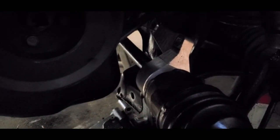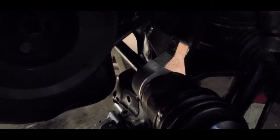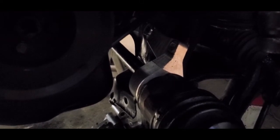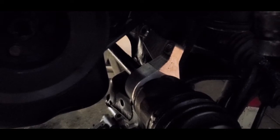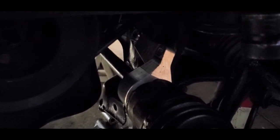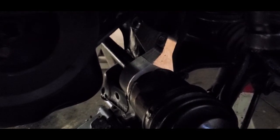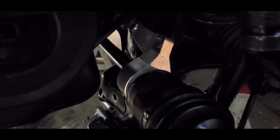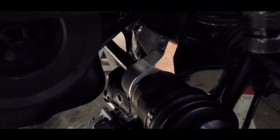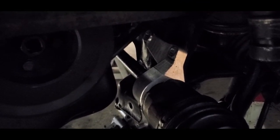IPT Transmission sells a seal — it's a brand new seal with a couple small spacers behind it that push the seal out a bit. I purchased it; with shipping I think it was around $50. I didn't end up using it though because I already had the Jeff Bush bracket, and I realized I only needed one or the other. I have no experience with the IPT seal, so I can't give feedback on it. But anyway, for a six-bolt 2G you do need the bracket; for a seven-bolt you may not need it, though you do still need the correct shaft.